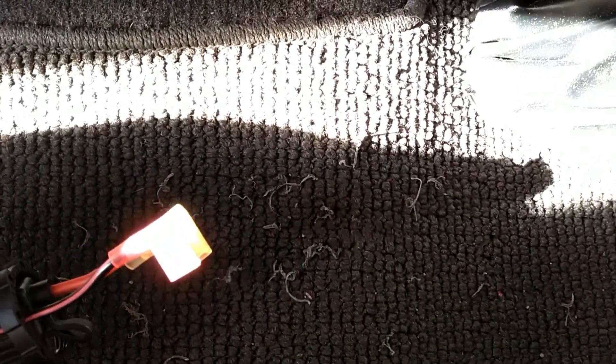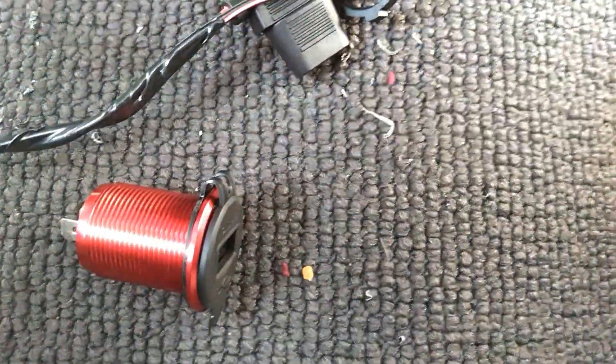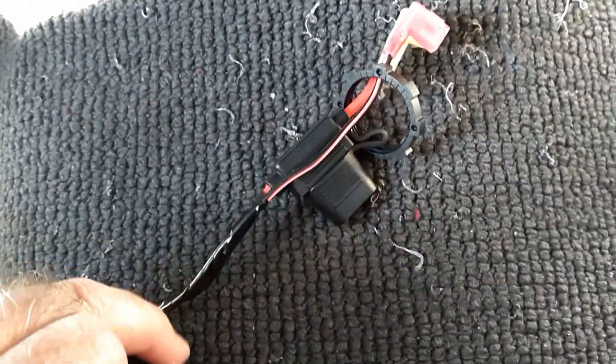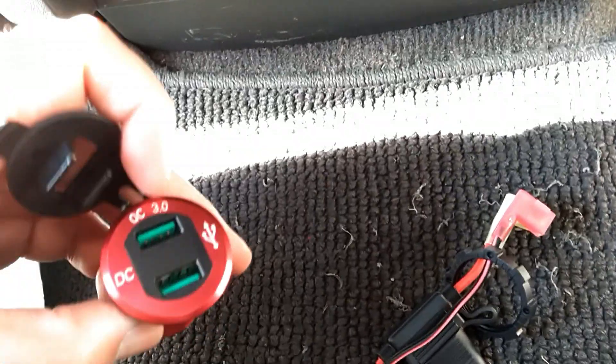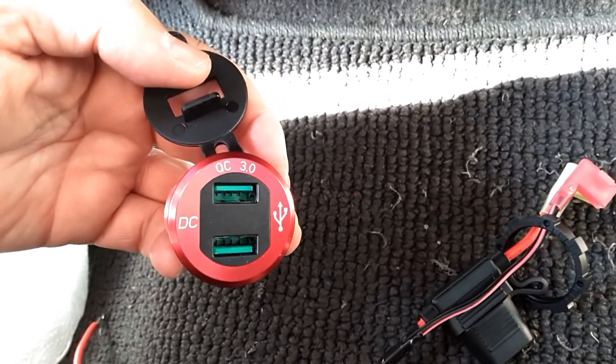I just fabricated myself a little harness here. I used some right-angle spade connectors and put an inline fuse, although this is actually going to get connected back into the truck's harness. Down in here — that's the back of the center console. As you probably know, there's a 12-volt cigarette lighter up inside there, so I'm just going to tap into that. This little charger here is going to give me a voltmeter readout and also be able to charge two devices simultaneously. So this is a nice little piece, and I'm going to go ahead and finish up the install here. Catch you in a few minutes.